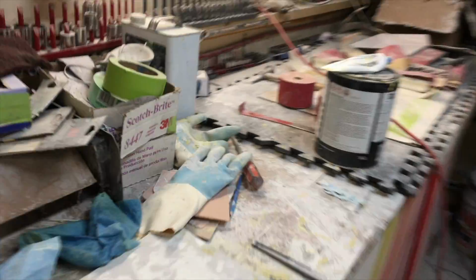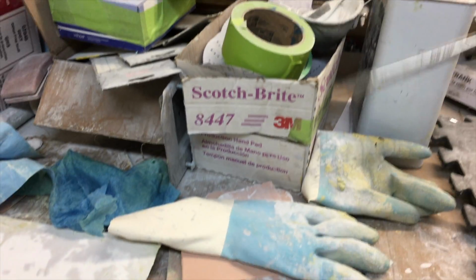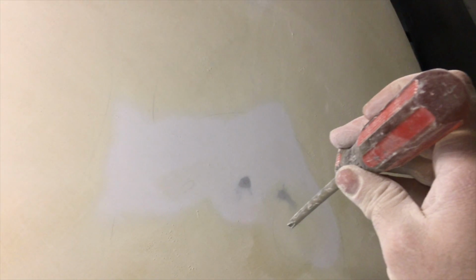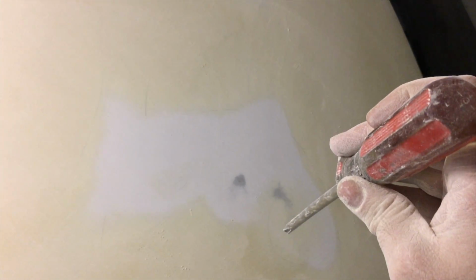That's for glazing putty later. I got this dent to come out of here. Like I said, it was a high spot, and a trick my dad taught me: you go grab yourself a screwdriver, and it's not hammering on it as I showed you earlier. It's literally just putting it on the surface, and with the palm of your hand, gently tapping, especially on a roof this thin.